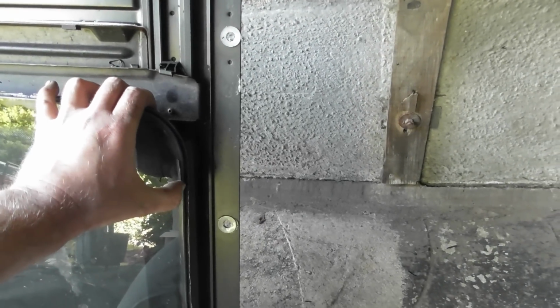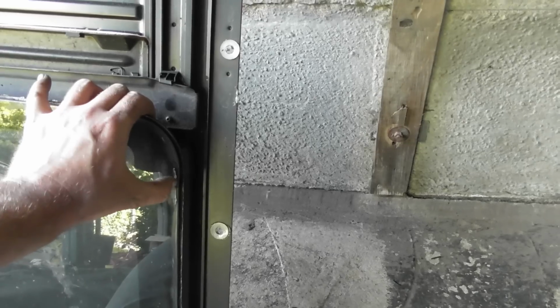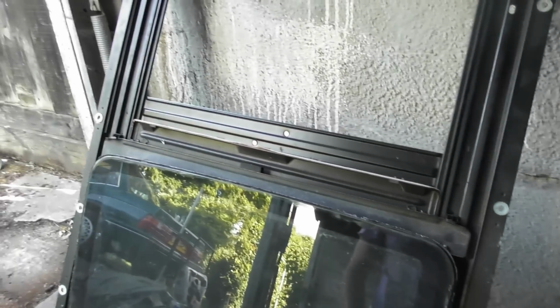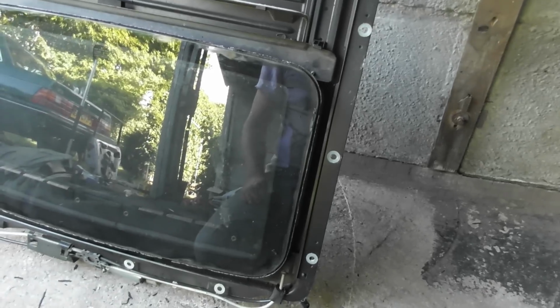Whatever sealer is on there, it feels like a kind of silicone, so my hands feel slippery at the moment. There's no way that my rust killer is going to stick to that metal or do its job properly if I don't get that off. So I'm going to go find some panel wipe, degrease all of that, and then paint it with a Hydrate 80.